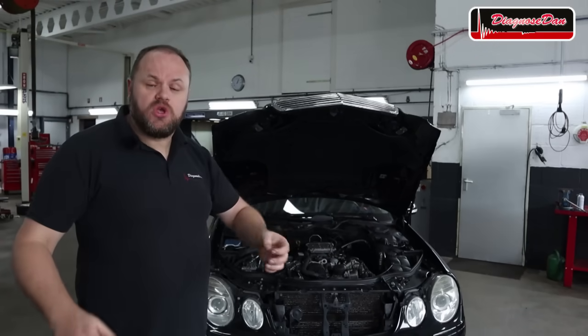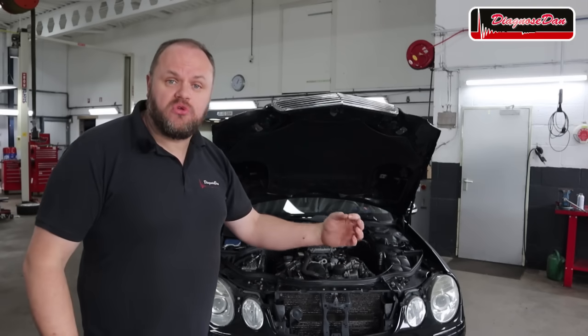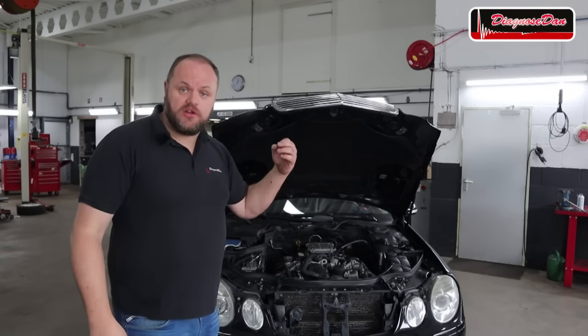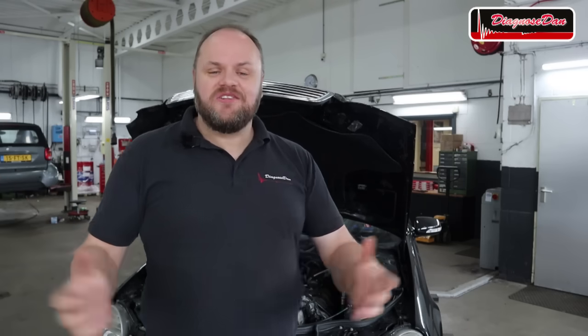Almost all systems pass without any fault codes. We do have a fault code stored in the engine computer for a camshaft solenoid, in a door module for a heated mirror, in a phone adapter for a microphone, and there is a history code in the ABS for low voltage on a solenoid. But none of these codes should prevent this engine from cranking. Now where should we start?